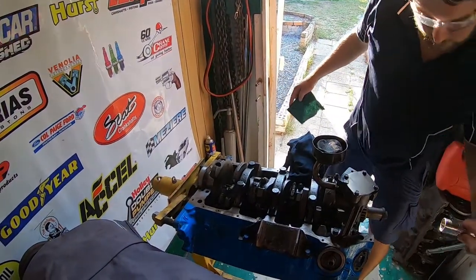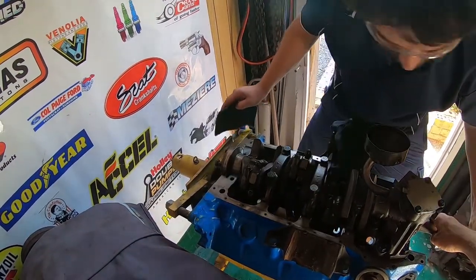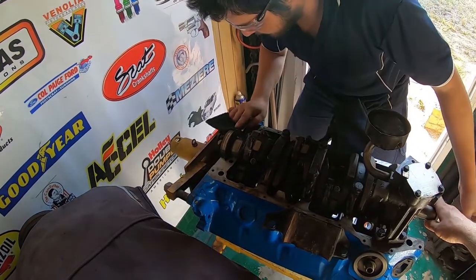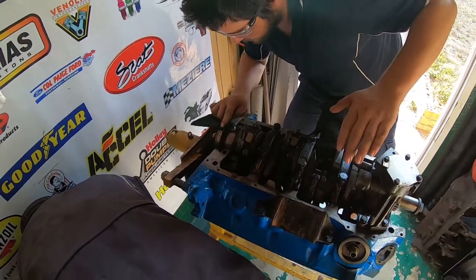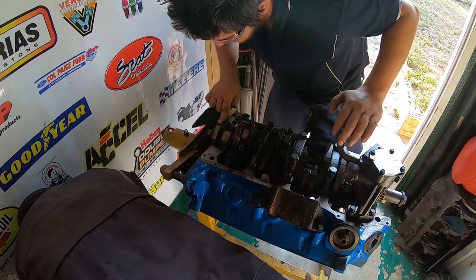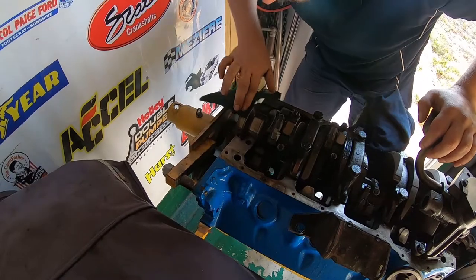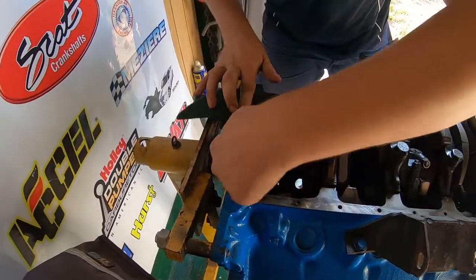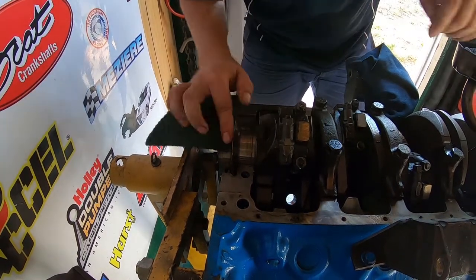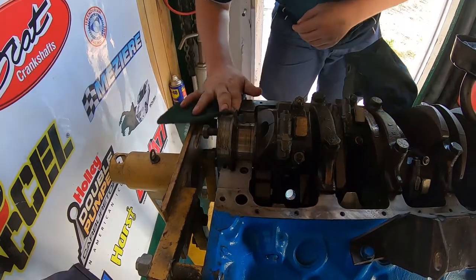I'll gently roll the crank over to reveal the dirty part — go a little bit further — and I'll do it in three stages. There's a lot of rubber stuck on this little 45-degree sort of half cross-hatch that's here. It's very interesting when you buy stroker cranks — the reason you need to run the one-piece rear main seal is because they can't do this one little finish here. Such a simple thing — they do hundreds, thousands, millions of these cranks.